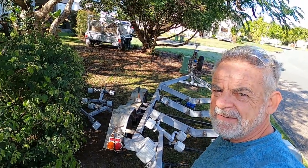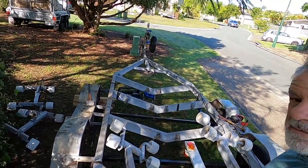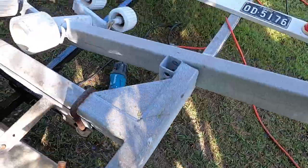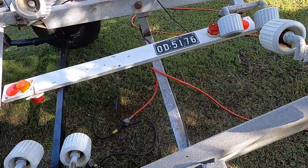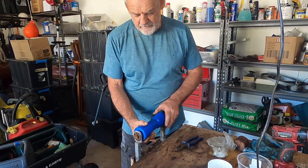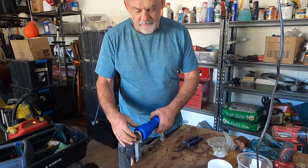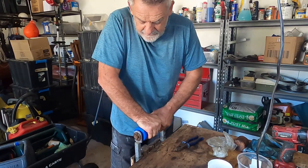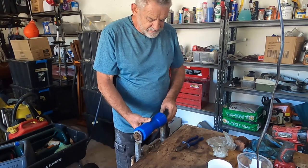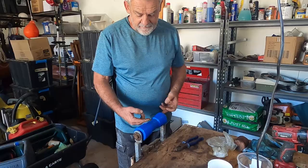That's the hard part done — all those rollers and wobble rollers removed. These bolts will be replaced with new ones. The back ones don't need to be removed because they're not adjustable. This is where it starts if you want to save your back when getting your boat on or off the trailer. The shaft running through here is seized, and once it's weighted it's not going to slide at all — that's why you see people straining their backs. I'm going to take these apart, knock the pin out and grease it.